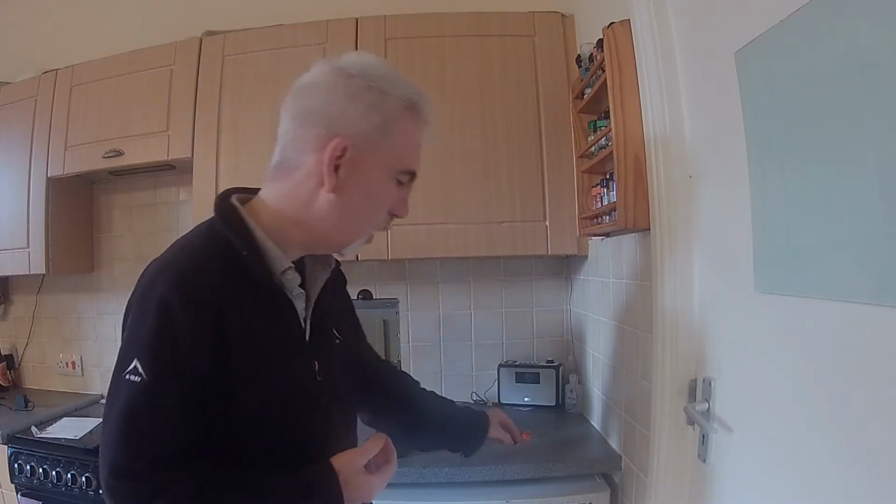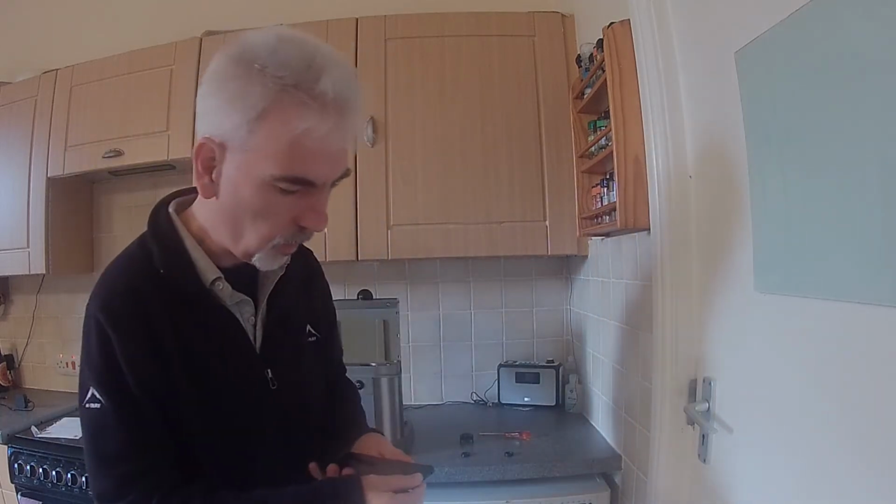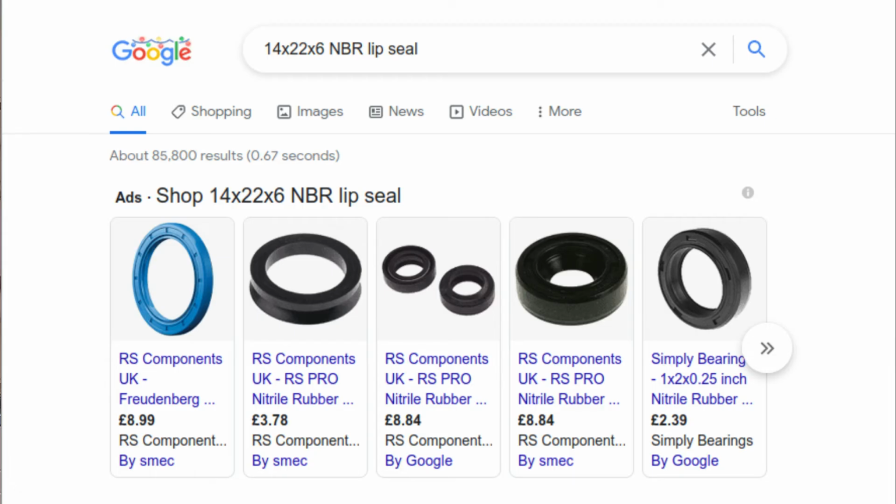Now, I said NBR, but this stuff also has half a dozen names. Here's a Wikipedia article on nitrile rubber, also known as nitrile butadiene rubber, NBR, Buna-N, and acrylonitrile butadiene rubber. And if that's not enough, it's got trade names including Perbunan, Nipol, Krynac, and Europrene. If you search for 14x22x6 NBR lip seal, you'll find the kind of thing you're looking for.